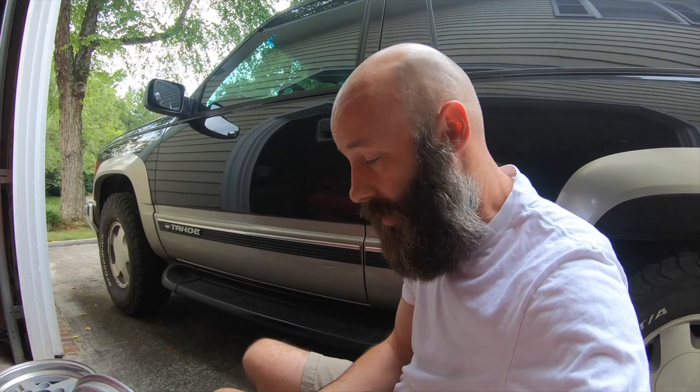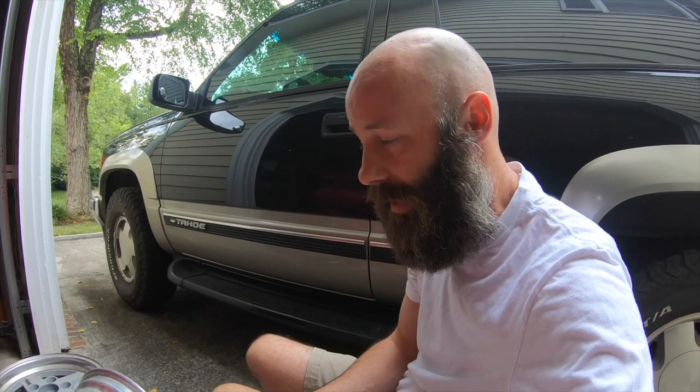The 225/50/16 goes on the front and on the rear. If people are at a tire shop, they'll rotate them without knowing. I've seen people buy these cars and the fronts are too far inboard, and they're fussing about the rears rubbing because the offset's different. So just know that the fronts are supposed to have a bigger lip on the 87 to 91 Saleens — the regular production cars. This does not include the SSC, the SC, or the 88 SA5. Those are a different production model. This is just for regular production cars from 87 to 91.